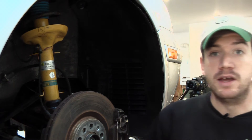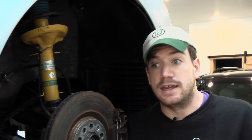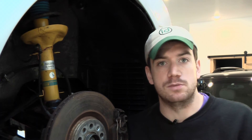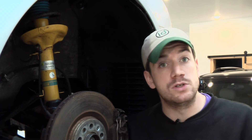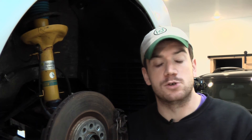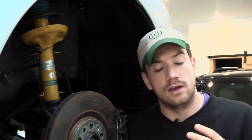The question is, do you need this? Well, it's kind of up to you. The OEM factory intercooler system is not too bad, even without the vented fender liner. As long as you're not in high altitudes doing towing and you probably don't have too many power modifications, your intercooler is not going to be close to being heat soaked. If you do have power modifications, you're running more boost, or you do a lot of towing, or you're in high altitudes where your turbocharger is going to be working harder, that's going to put more stress on the intercooler and raise the intake air temperature. So putting a vented fender liner in may help you quite a bit.